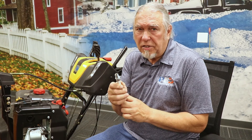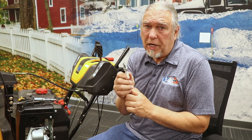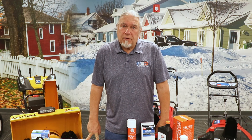Spark plugs usually every 30 to 50 hours need to be at least checked or replaced. But really, a spark plug is relatively inexpensive. If there's any doubt that it's in good shape or not, just replace it — and always pick up a spare so you have one on hand. I hope all this information helped. Thanks for watching, and if you haven't already, please subscribe to Power Equipment Direct for more tips like this.